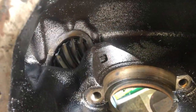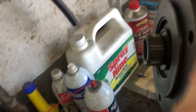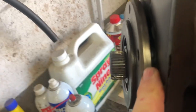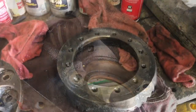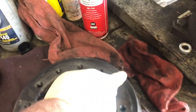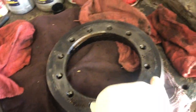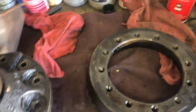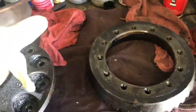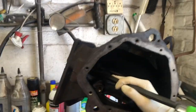We've started — you can see with a punch we're tapping this plate out from the inside. We've got a little gap there and we're going to pull this out. The ring gear comes off just by tapping around the edges with a hammer and a large punch, so you're not making little holes in this thing. A couple of good whacks as we spin it and that comes off no problem. We're going to finish knocking this thing out.